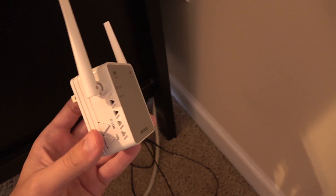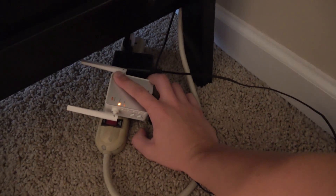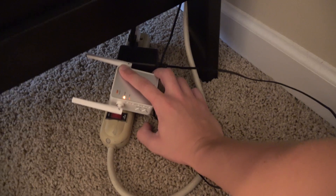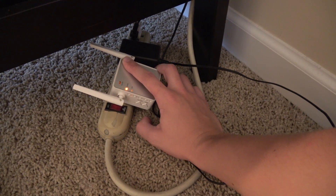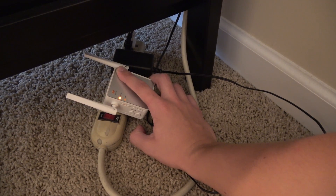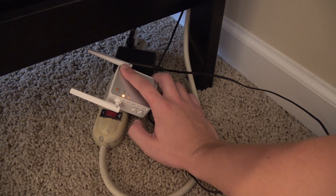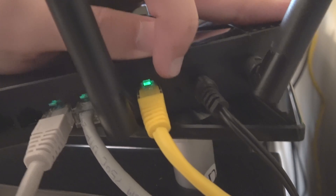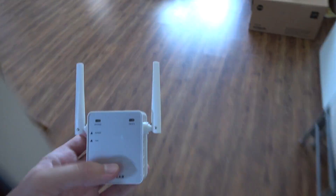For the initial setup, you're going to have to take your Wi-Fi extender and bring it fairly close to the same room that your router is in. First you want to turn on your Wi-Fi extender, wait for it to boot up — when it's done booting up the power light is going to turn green. Then you're going to click WPS on the Wi-Fi extender and then click WPS on your router, and after a few minutes it should sync together. When it's done syncing you're ready to go — take it anywhere you think will be most beneficial.